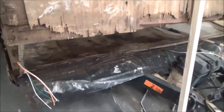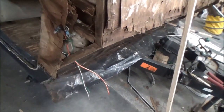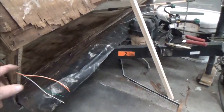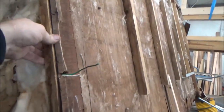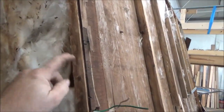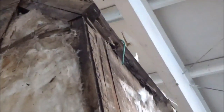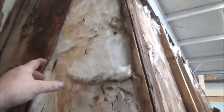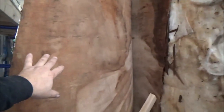I don't want to open up a whole can of worms for this customer, but we're going to try to stitch it back as best we can. We may have to cut that and add a piece with a strip inside there. This piece here I didn't like because it was wet — I want to know if it'll dry out. That sounds solid, but is it water stain or rot? When it dries out I'll know better. All of this was rotted anyway, so I'll skin another piece inside this whole triangle area and relaminate the siding.